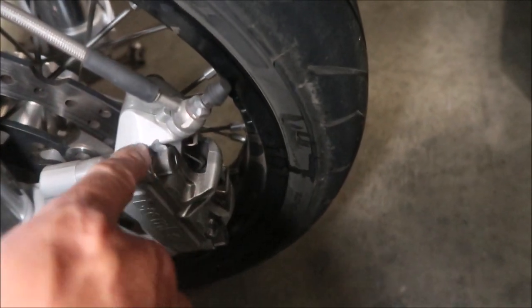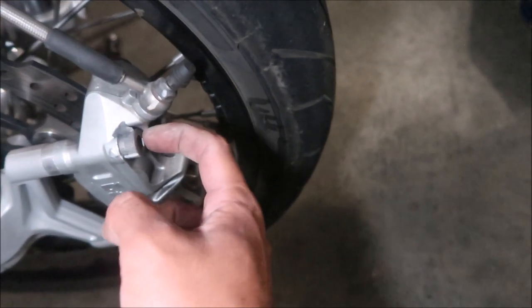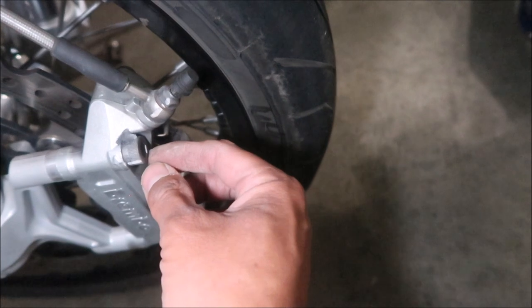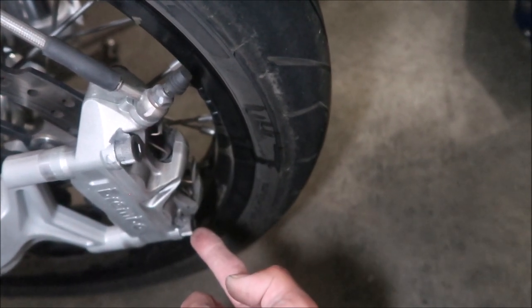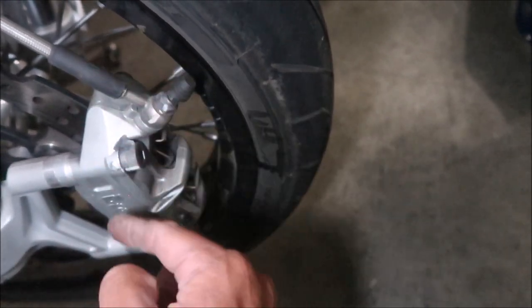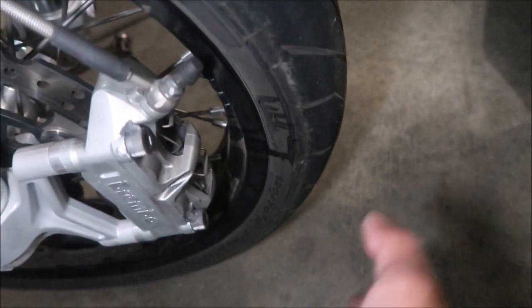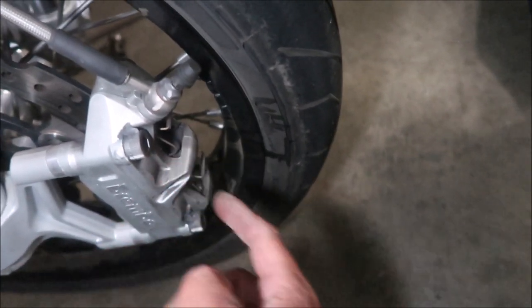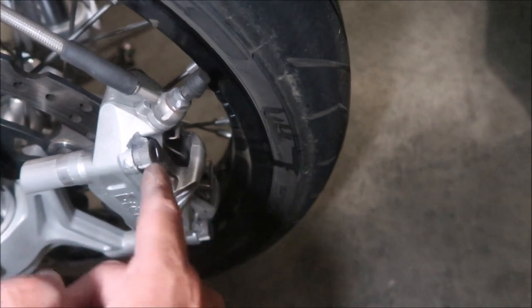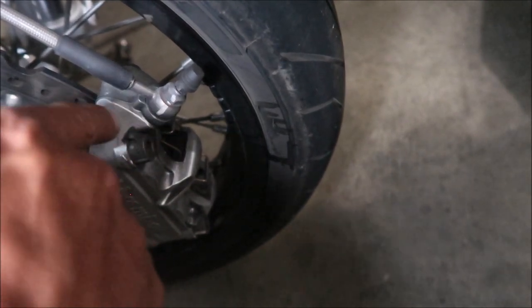What I'm going to do is drill it and show you guys how to safety wire it later. We're going to drill it from the 12 o'clock position — I feel that's the best position. It's going to form an S-shape when you safety wire it. That way when one loosens, it's actually tightening the other one. You don't want it to keep on loosening, so there's a certain way to safety wire it.